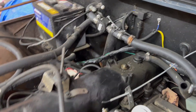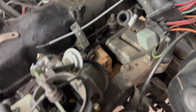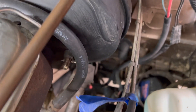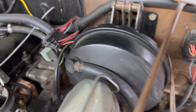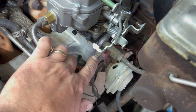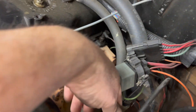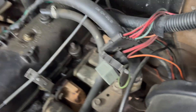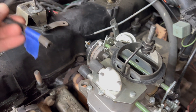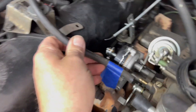I'm gonna get started on this - never done it before so this is a new one on me. On mine I only had a couple of things to take off the carburetor. I had to disconnect the manual choke, there's a vacuum line that goes to the base of the carburetor which is needed for the power booster - or actually I think that's for the choke, probably not needed anyway. The spring goes to the throttle linkage, and I disconnected the PCV valve - this hose goes to the base of the carburetor so I have to get that hooked back up on the new system. Also the vacuum for the distributor - that's the most important one - that one plugged into the side over here.